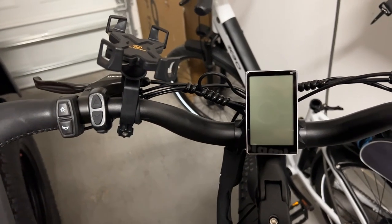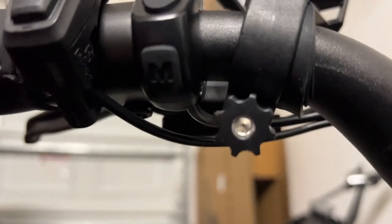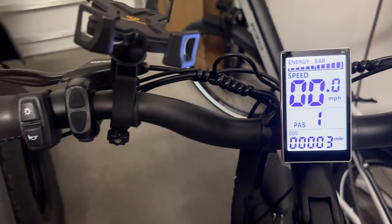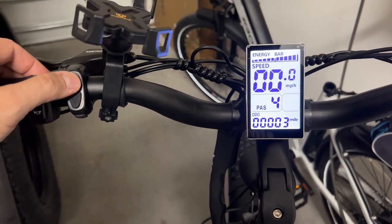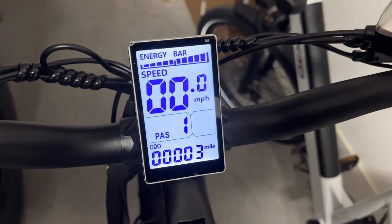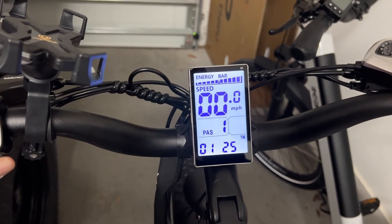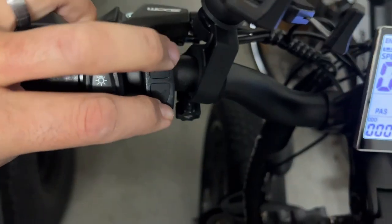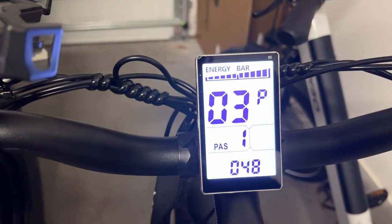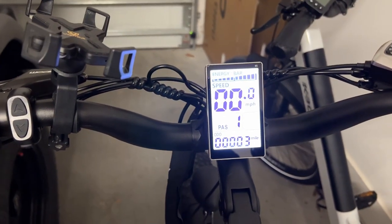So here's the controller — this is what you have to do to turn it on. This little controller looks a little different in 2022; there's less buttons. You're going to see the M mode button on the bottom — hold that for a second or two and she's going to pop on, energize, and you're going to see your display kick on. You're going to see it's in pedal assist one; you can change that all the way up to pedal assist five. There is a way to get into the back end and change the pedal assist miles per hour — pedal assist one caps out at about 10 miles an hour, which is a comfortable little speed. You can cycle through a couple of different settings: ride time, your odometer, your trip meter. Just press the M on the bottom. If you hold these two buttons together, you can get into the modes — look in the manual or on the website; there are a bunch of videos which will tell you what all these things are for. You probably shouldn't change them out of the box, but you do have that flexibility.